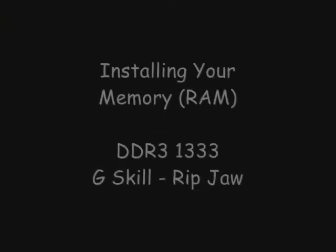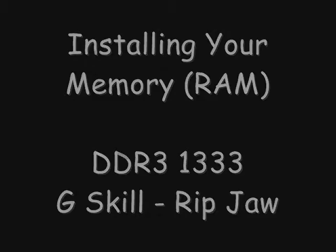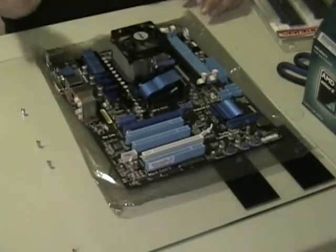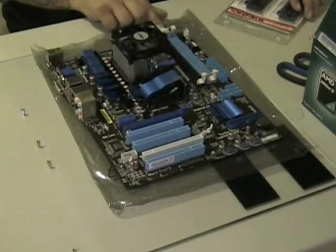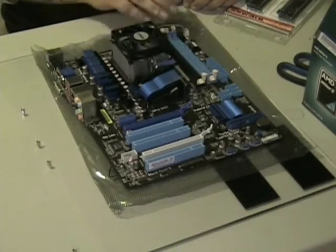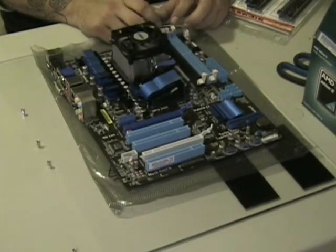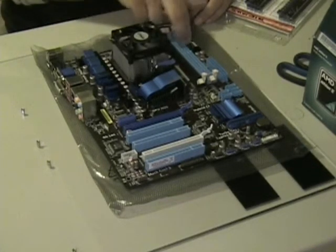It is in place. Now we're going to go ahead with the RAM module installation. It's going to be the same as it is on Intel boards, AMD boards, whichever. When you look at your slots, AMD is always going to have the slots staggered — you'd see black, black, blue, blue, or whatever the colors may be. They're always going to be matched in pairs.